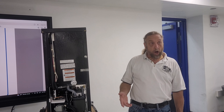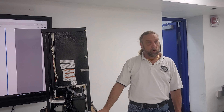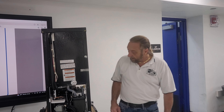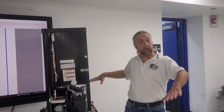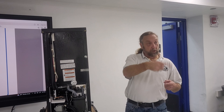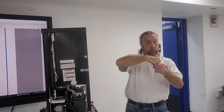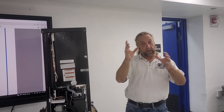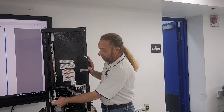If you've got 50 pounds of ice in here and the machine shuts off, that ice is going to melt. If the customer doesn't realize the machine is off and the ice melts, it can still overflow and get water on the floor. The recirculation has a pipe that goes to the bottom of the ice bin but it's not sealed, so when ice melts it runs down the same drain.